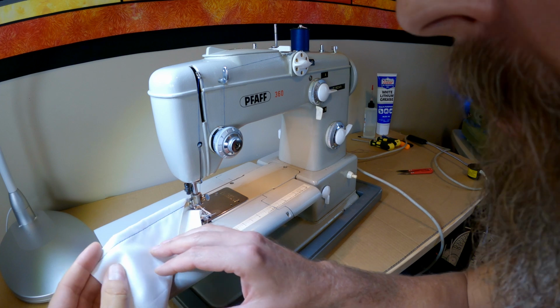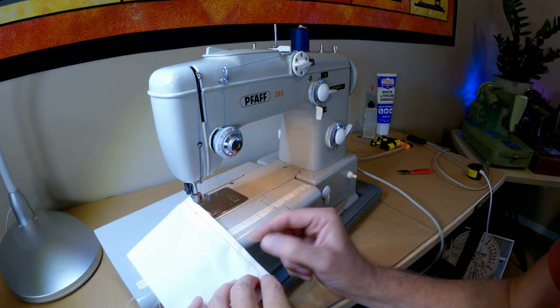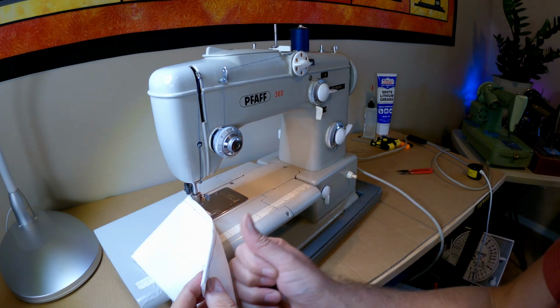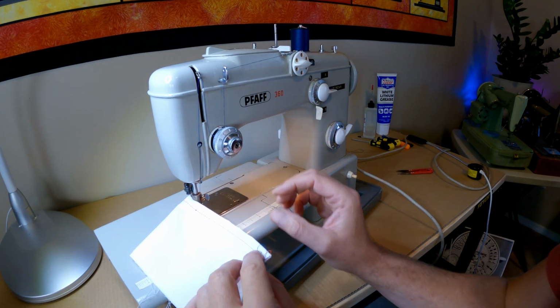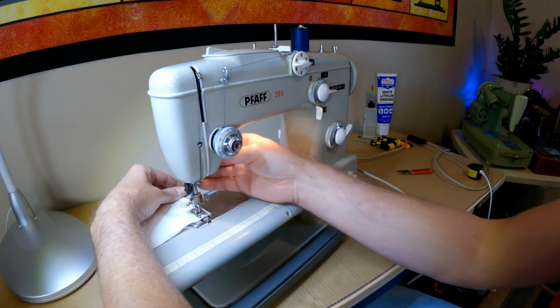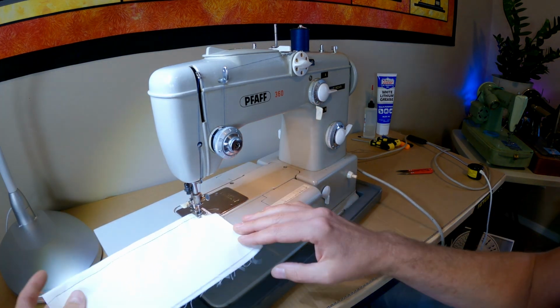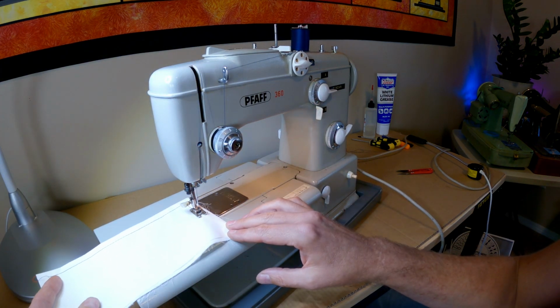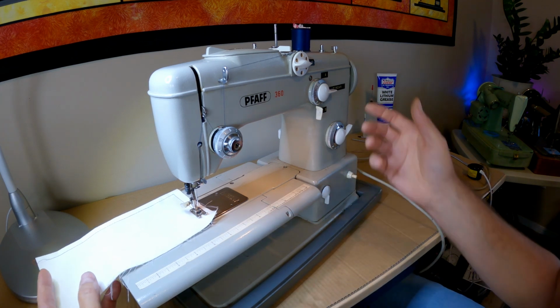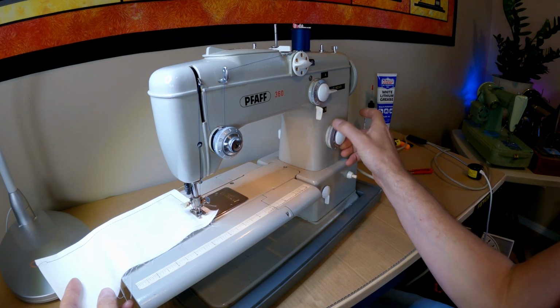I don't think that the tension, I need it a little tighter coming up. It's coming. I need it to come up maybe a little bit more. I might need to play with the tension. I didn't check the tension really on the bobbin down below. That could be an issue as well. But it's working. I also have an old needle. I mean, who knows how old this needle is, right? Let's go a little smaller on our thread.